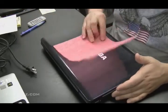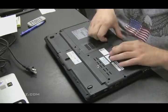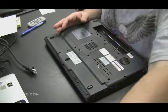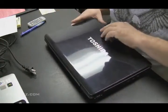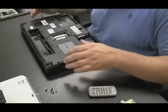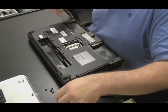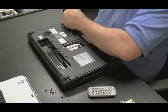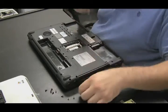What do you do if you have a water damaged laptop? The first thing to do is pull out the battery and don't even try to power the laptop on. Get ready to take the whole thing apart because we're going to inspect the motherboard and see if there's any moisture or liquid still on it. If you suspect there's any liquid in the motherboard at all, do not power the computer on — pull the battery out, take it all apart, and look at the motherboard in every little crevice.